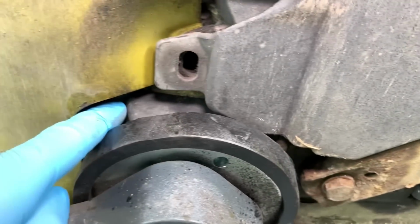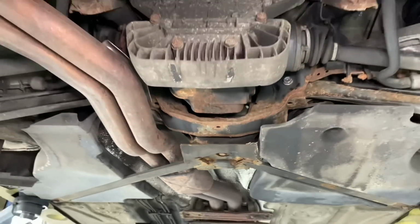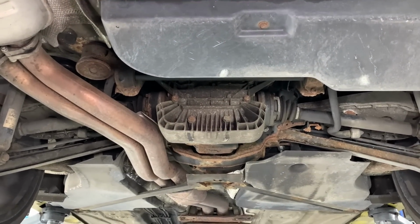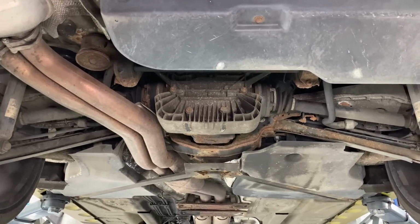There's a little bit of a crease in that one that's started to just go up. So first thing with anything is to get it all stripped apart, get all of this hardware off, and axle out, fuel tank out, brake pipes and exhaust system, prop shaft, heat shields, things like that, and then look at the actual structure of the vehicle in closer detail.